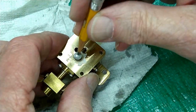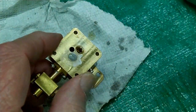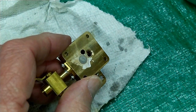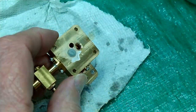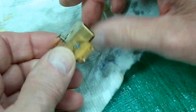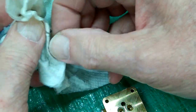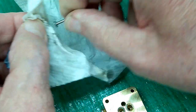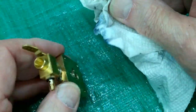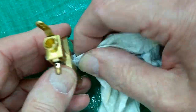I push the valve down in there. Then I have a small chuck — I put that on there just so I could work it back and forth by hand. As soon as I start getting some black material in here, I know that I have taken away some brass. We're not dealing with a very large surface here. This is an experiment; I don't want to get too carried away. So I'll take that out, clean it up, and try that magic marker again. When we get done with this, I want to flush it out with WD-40 and get everything clean, because we don't want any abrasive material going in where the piston is.